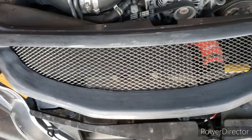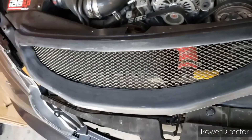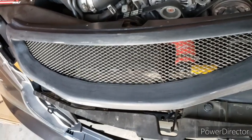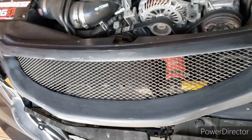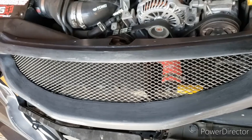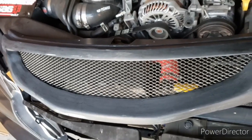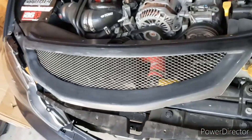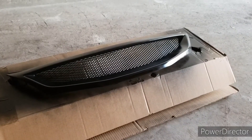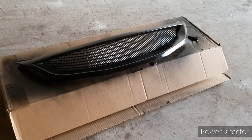As you can see, it's scuffed and dull, and you can see some of the white showing through the black now that it's been sanded. We'll get this put away from the car and up on something so we don't get spray paint everywhere, and we'll get a nice even light coat to go over it the first time, make sure it sets well and completely dries, and then we'll start working on more coats.